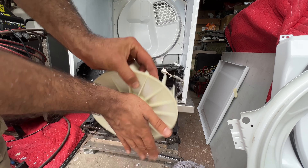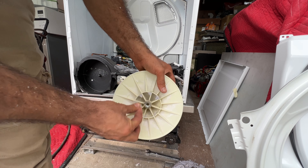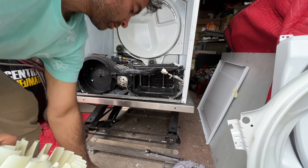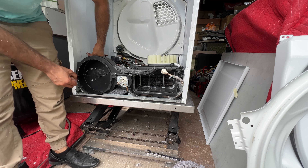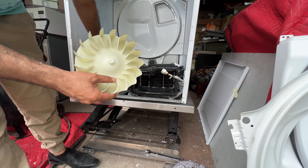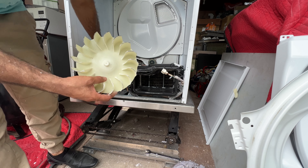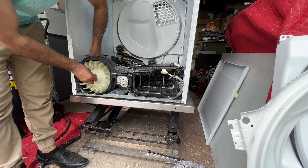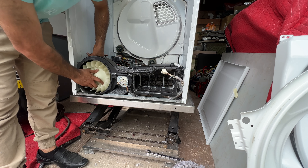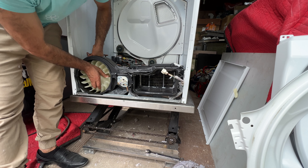I have to add the blower back in — if I put the drum in first, I won't be able to put the blower wheel back in. It even tells you on the wheel which way to turn to remove and which way to retighten. Counterclockwise as we're installing the back end — eventually it's going to stop, then put just a little bit of pressure on it, that's all.